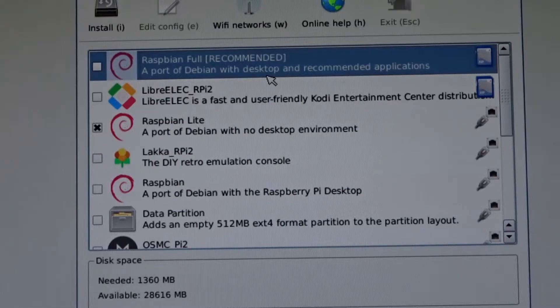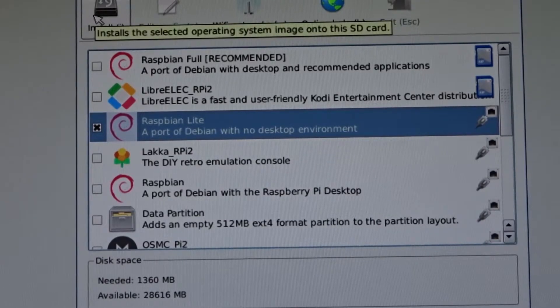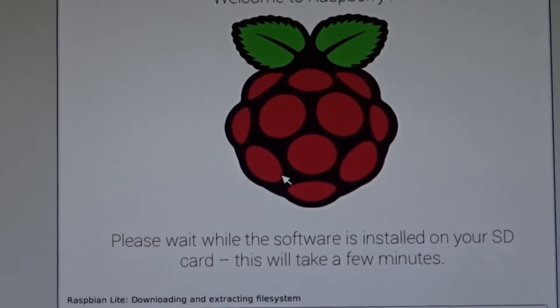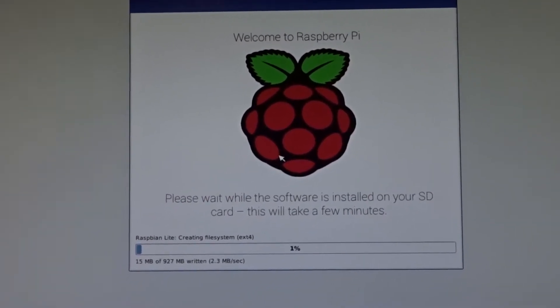This is not something I'm going to have a monitor connected to - it's going to be sitting in a box rack mount somewhere on a stage, completely away from the control itself. So we'll go with Raspbian Lite to save time. It's going to pull the data through the internet and install via WiFi - if you have hardwired network you can connect that and it'll be a bit faster. We'll let this install and come right back.